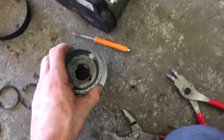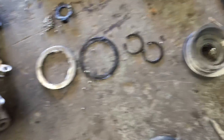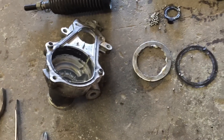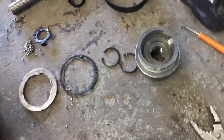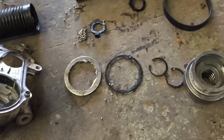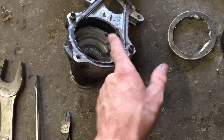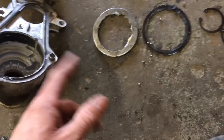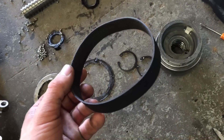There is literally nothing else wrong with this entire gear. I've got a new gear - fortunately it comes as a whole assembly - so I'm just going to put a whole new steering gear in the car and that should take care of the problem. Maybe other Ford techs out there watching this video have an idea of what's going on, what causes that noise, because I've taken this entire gear apart and can't find anything wrong with it other than that little bit of funky-looking black grease right where the belt runs.